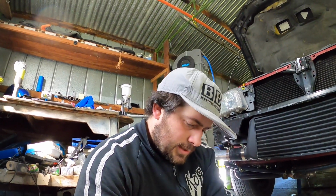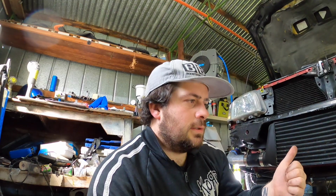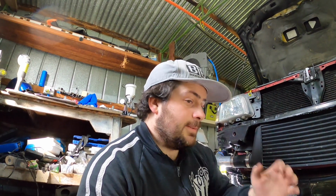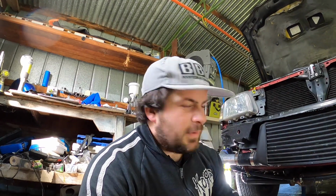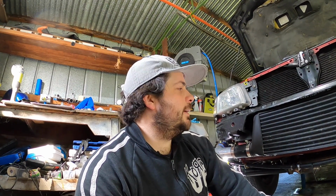So we go with that wastegate and the new MAF scaling as well. So I'll get that pump on. I need to get a switch or a push button start. So that won't work unless the scavenger pump is on, so I can go onto ignition, push it, it won't start, so we can do all the remapping and stuff in that phase. Turn the pump on, and then I can start it. And I need a switch for the green terminals too. So, a bit of electrical stuff to do as well. We'll see how this wastegate goes, and then we should be able to hold a boost level.